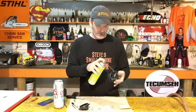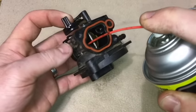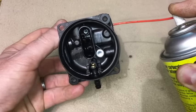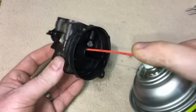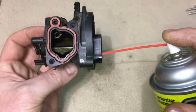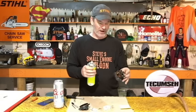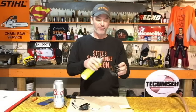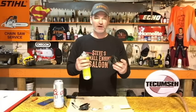The hole on the left side is a little bit different. On some carburetors I can spray into there and it shoots right out the hole where you pulled the cartridge out, and if I put the red tube in the opposite way and squirt in there, the carb spray shoots out that hole too — it goes both ways on some carburetors. I've even taken brand new carburetors right out of the Briggs & Stratton box and tried to spray carb spray through there and nothing goes through either way. Whether or not carb spray goes through that passageway, I put both types on the same lawnmower and it runs absolutely perfectly. So if you can't get carb spray through that passageway, I honestly wouldn't worry about that.